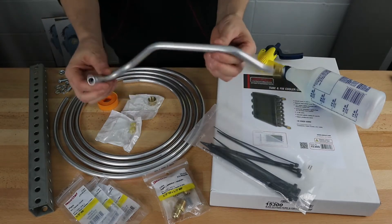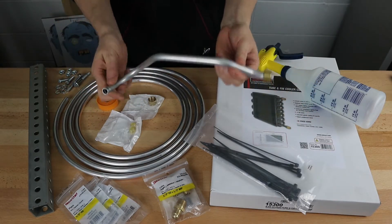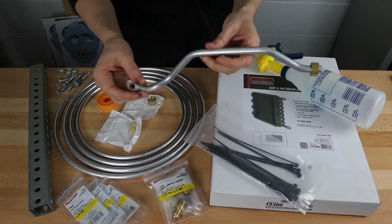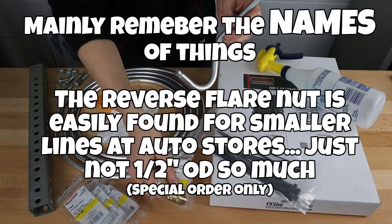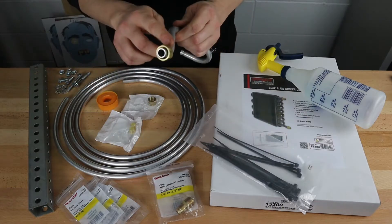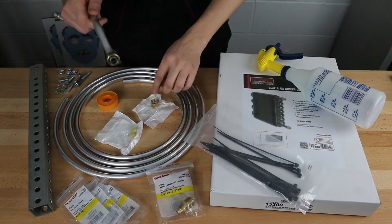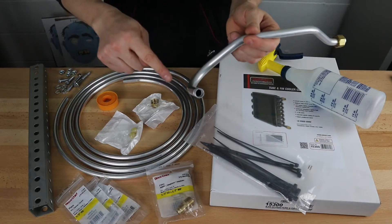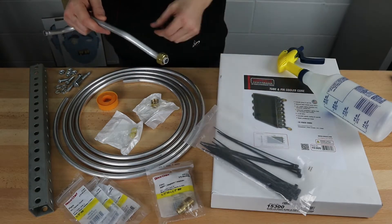This is the original part that was mentioned. We are really reproducing this end and this end here. This no longer has what I believe is a reverse flare nut — it has the same threading as a flaring adapter for hydraulic fittings, but it doesn't fit in. So we're going to be reusing the reverse flare nut on that side. You can actually get this fitting over here — I got this one at Northern Tool. This part that goes into the compressor is now going to be cut off and going into the radiator, and then the side that goes into the tank is going to be coming out from our water trap.